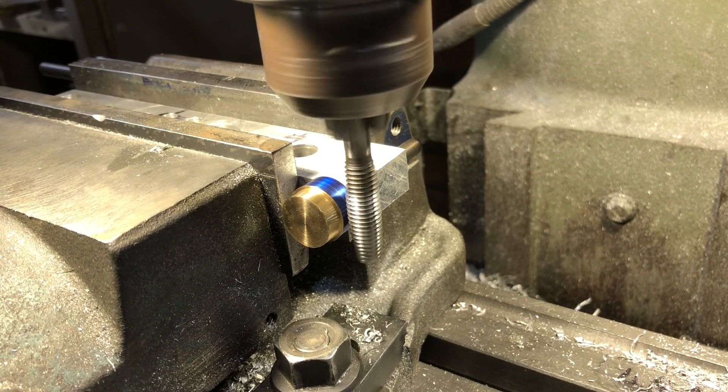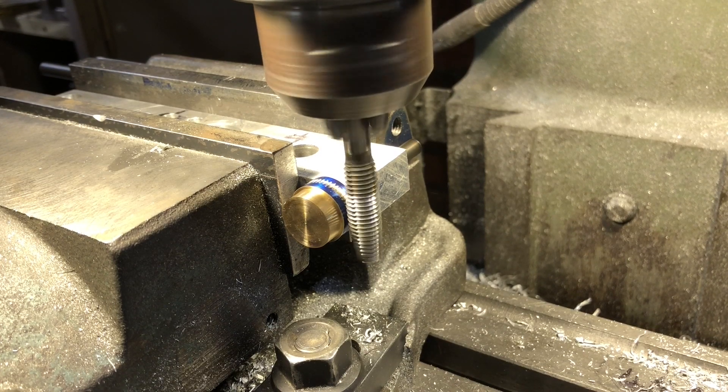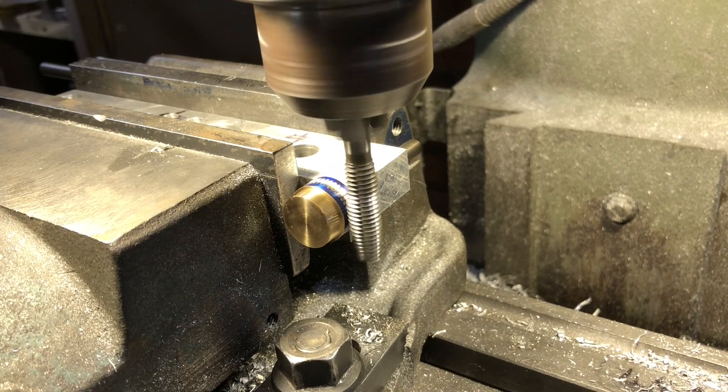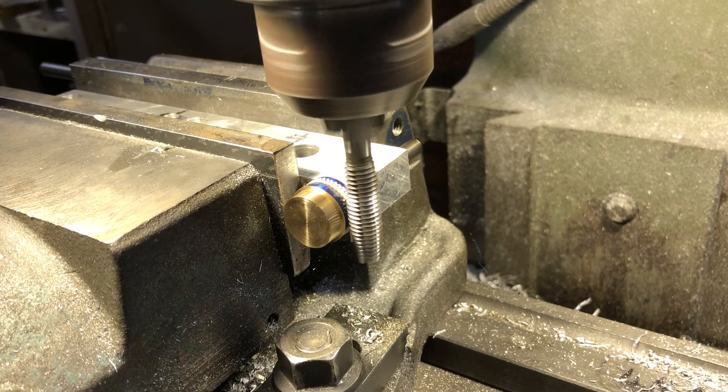This is something I've never tried before — this is my first attempt at making a worm gear. I've got a tap spinning in the mill and I just offer the work up to it. As it comes into contact it just starts rotating the work all of its own accord. It eventually finds its own centre and you just keep cutting in deeper and deeper. I've gone in about 2.1 mm here and it forms a perfectly good worm gear.